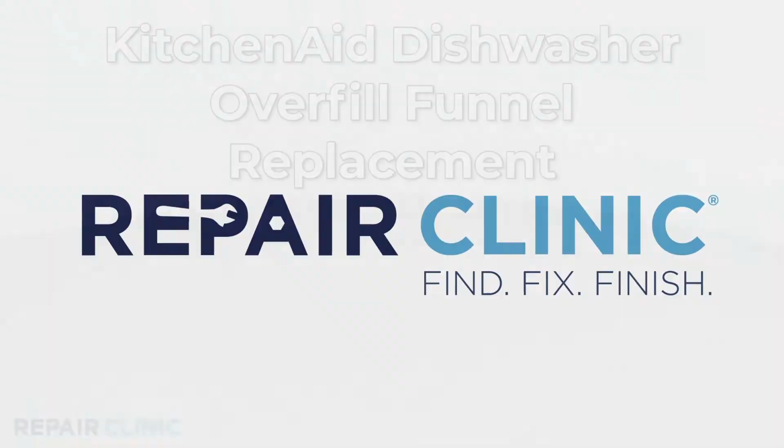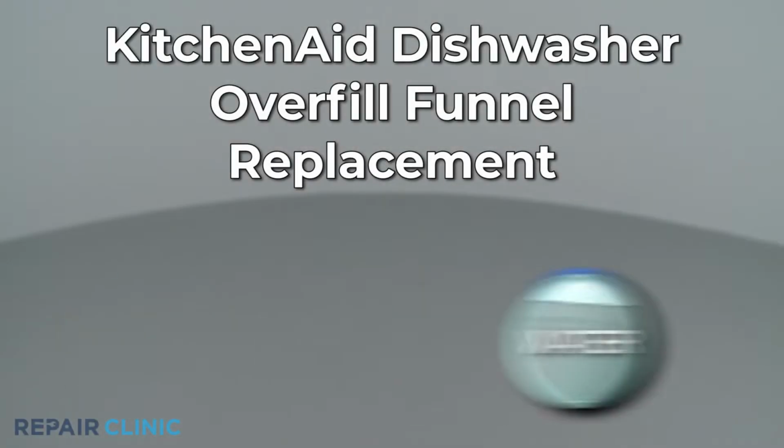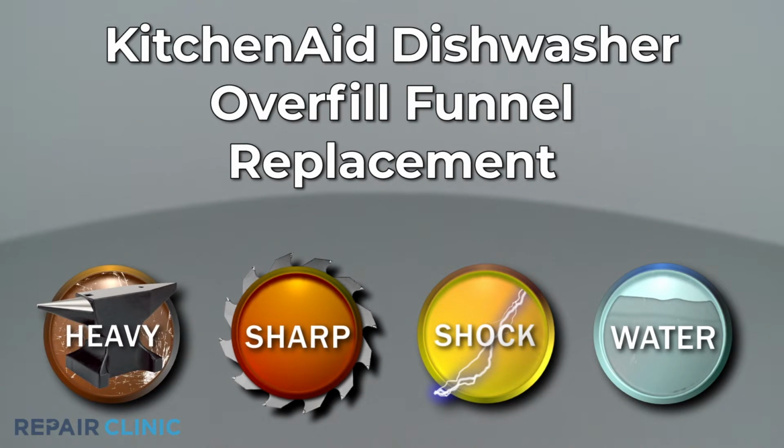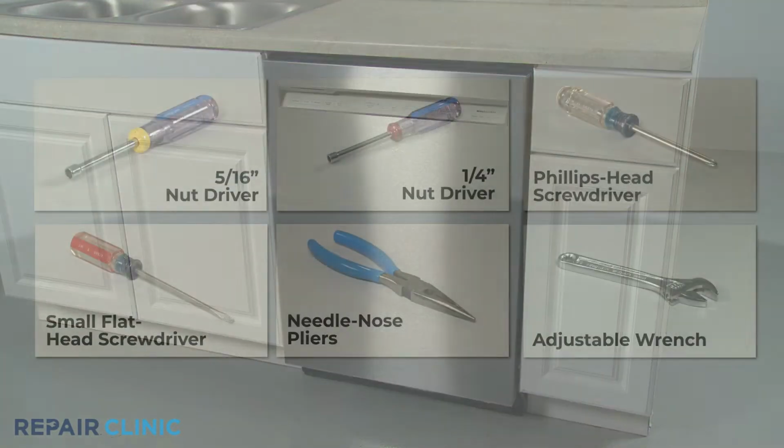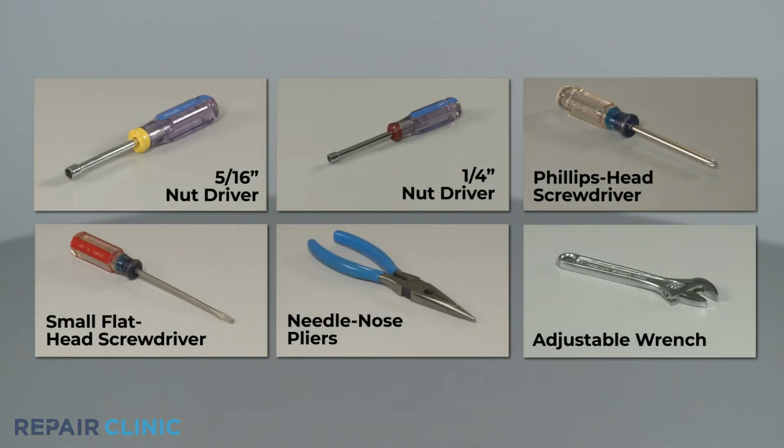Since Repair Clinic encourages you to perform this repair safely, a warning icon will appear when you should use caution. To replace an overfill funnel in this KitchenAid dishwasher, you will need a 5/16" nut driver, a 1/4" nut driver, a Phillips head screwdriver, a small flathead screwdriver, needle nose pliers, and potentially an adjustable wrench.